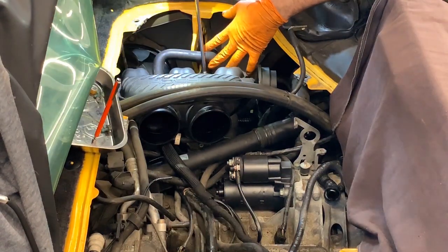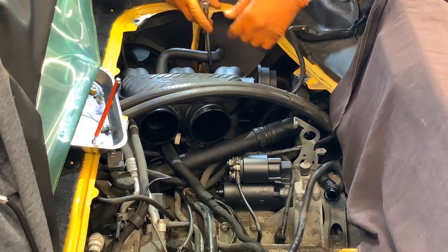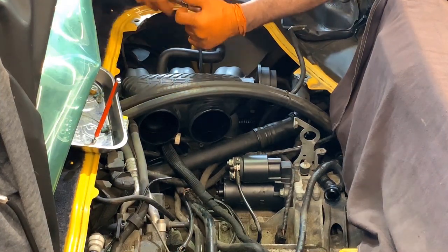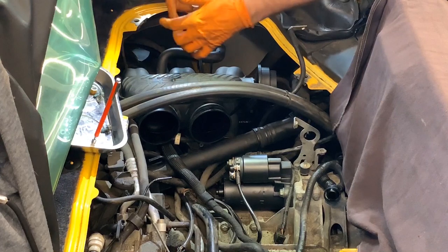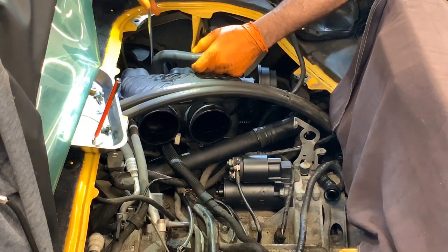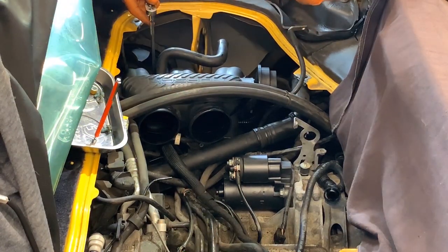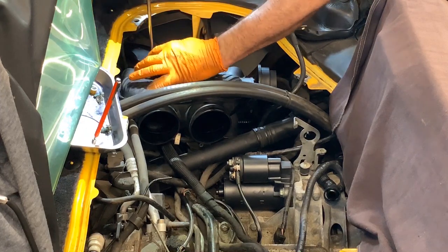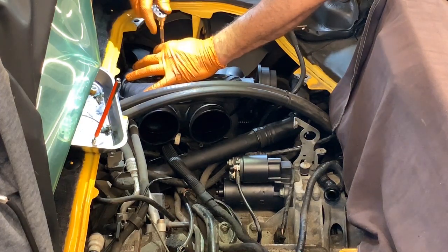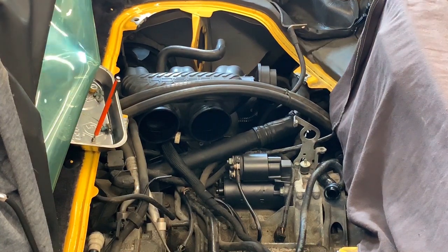If you're a new tech and you want to get the torque specs, no problem. For 10 millimeter bolts, usually no more than 10 newton meters. And this is not a cylinder head, so the manifold itself has a bushing, so you're not squeezing the plastic, right? All right, those are done. Hopefully you guys are looking.